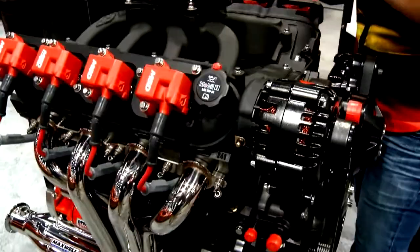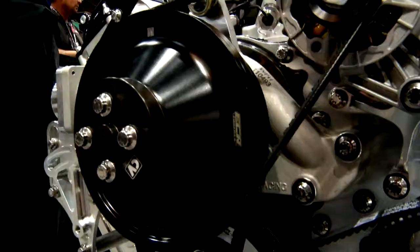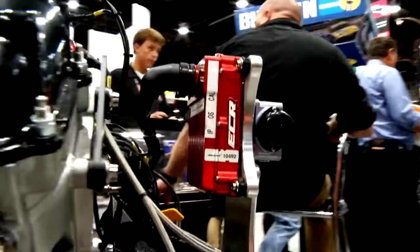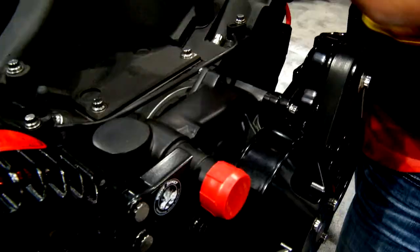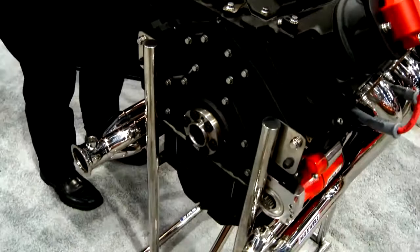And when we take a look around here, this is not only doing it right with the right fastener, but we've got stainless. It's dressing this up right. We've got all the motor stuff done here. A lot of folks are changing the tranny back here. And Chris, what problem are they going to run into? Well, when you put the LS engine in your car, you're going to want to maybe run the 700R4 overdrive or the Turbo 400 transmission, and then it requires an adapter. And we make a special bolt just for that adapter.